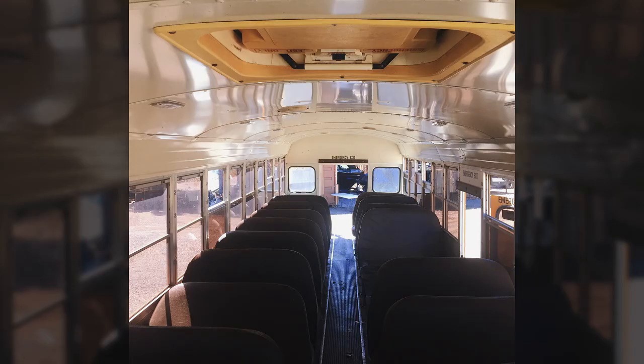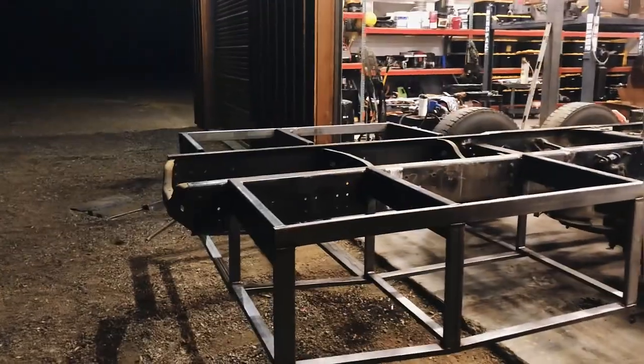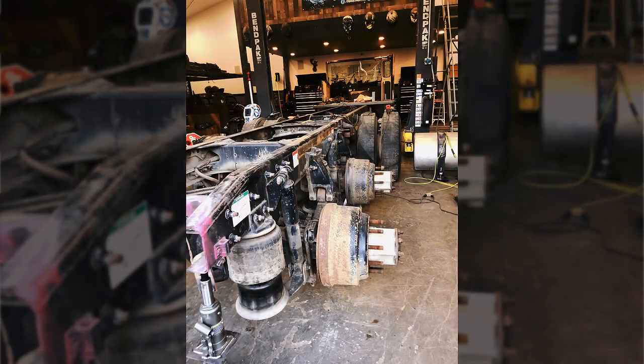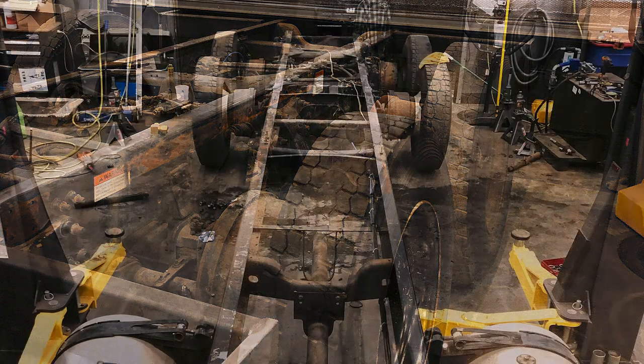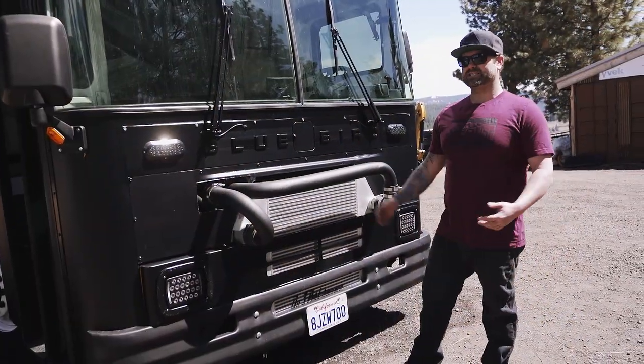We got into the design phase and said, 'Okay, we need a 16-foot garage to make this worth it — how do we accomplish that?' We couldn't just move the existing axle back, so we went to a local truck salvage yard, got a tandem bogey rear end off a totaled Freightliner, and welded it into the existing frame. That allowed us to extend the garage space the 10 feet we needed to achieve our 16-foot garage while still maintaining a good-size living quarters.